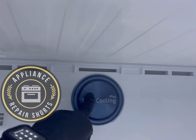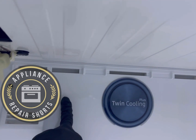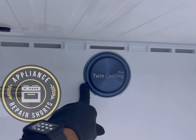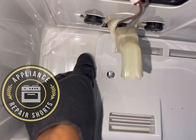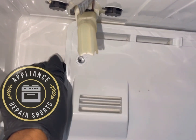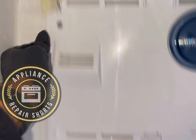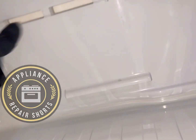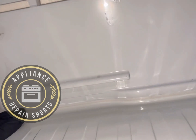If the fan is not on, you might have a bad fan or a disconnected wire. You'll also want to check for voltage coming out of the fan connector. Sometimes the fan can just be stuck as well. To pull the cover off, you can use a pick or small hook, or just grab it with your hand — just be mindful of the wires in the back. Start from the bottom since you have your ice maker there, then lift it up slightly and walk it out.